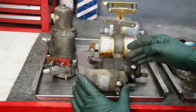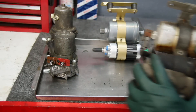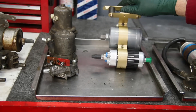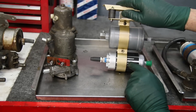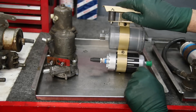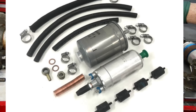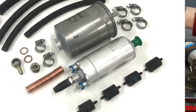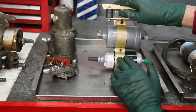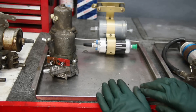Because so many people were having problems with these pumps and couldn't buy them, I set out almost a year ago to come up with a conversion. Here's the conversion — converting to a newer style Bosch pump. This is not a Mercedes pump; it has to have a lower pressure than the CIS pumps that came out in the mid 1970s. You can see I've got some special fittings, and the whole kit gives you all the hoses, the mounts, and everything. So if you have a 1969 to 1975 small 3.5 or 4.5 V8, I can help you with a conversion kit for your D-Jetronic fuel injection system.